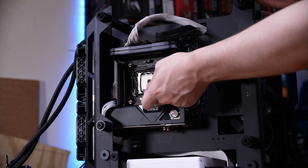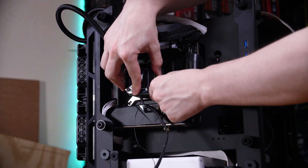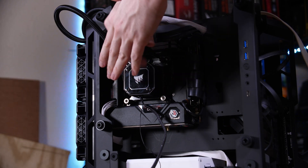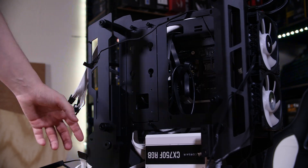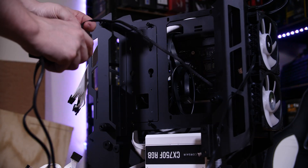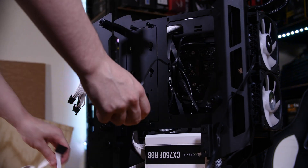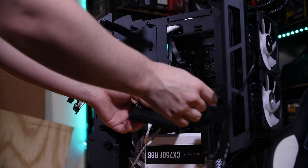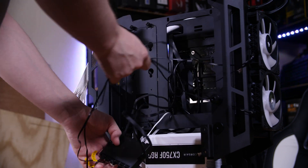Once you've installed all eight screws, put a grain-of-rice-sized drop of thermal paste onto the CPU and place the pump and block unit down onto it, using the four thumbscrews to hold it in place. This cooler uses an extra module to control everything including the fans and RGB lighting, so connect up all of the fan wires, the wire from the pump unit, the USB 2 front panel header to control it, and SATA power to power it. Also make sure you plug in the three-pin fan header sensor to the available fan header.